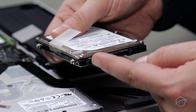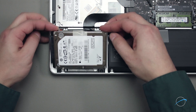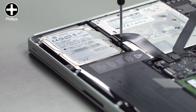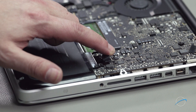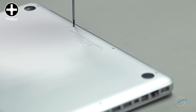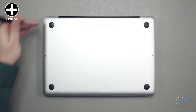You can now reattach your hard drive by sliding the SATA connector into place and setting the drive into the bay so that it lays flat. Then you can secure the drive by putting the retainer bar into place and tightening its two screws. You can now line the battery connector up with its socket and push it back into place. Then replace the bottom cover. Finally, replace the 10 Phillips screws starting with the longer three in the upper right corner, followed by the remaining seven screws.